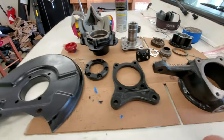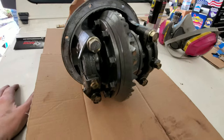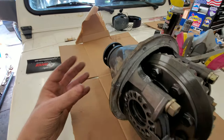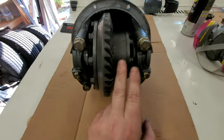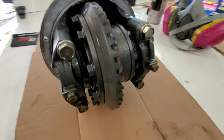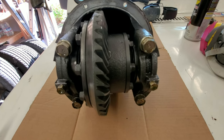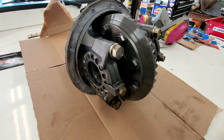We've got the majority of the parts that needed to be painted done, and it's now time to move on to the next step: messing with the differentials. If there's one thing I don't feel comfortable doing just yet, it's differentials — I usually take them into the shop and have a professional install a locker and gears. But in the Samurai here we're only putting in a lunchbox locker, meaning we're only replacing the spider gears and this carrier. The housing stays the same, so we're not redoing the gears. I've determined we're going to do a Spartan locker. I'd love to hear input from you guys, especially those who have wheeled these setups in their Samurai, because my number one concern has been strength using these stock axles.